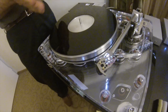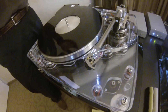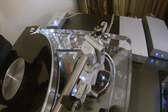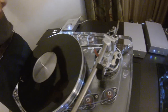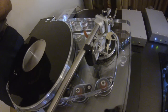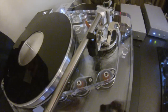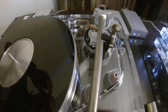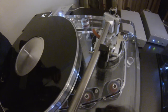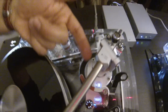It's always the suspension that gets compressed first, then pushes the arm out. Now, by using a polymer metal film rather than a sliding bearing, so this film is just basically doing this, you have no noise and you have no stiction. So it has constant friction in all directions. We also apply the anti-skate by a few microns thick film of silicon, so it has no resonances in it. It's a pain in the neck to actually cut it small, but it sort of profiles around the back here.